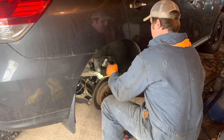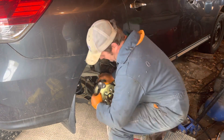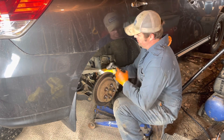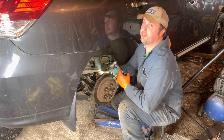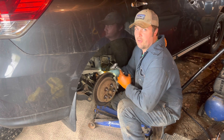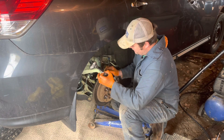We're going to have a look and see what's wrong. Here's what brought me in here — this will not move right now, but when there's weight on it, that will move back and forth. So we're going to put some tension on this, see if we can get it to move and see why. I don't know if you can see this in the video, but this right here will move — the bushing is bad. That's creating a horrible thunking noise when we're driving down the road that has my wife worried that the wheel is going to fall off. I told her all sorts of horror stories about what could happen if that went bad, but the wheel falling off probably isn't one of them. Somehow she didn't find that comforting. So we're going to change this spring — we're going to pop those out, let everything down, two 13s up in here that will let it come apart, and put it all back together. That is the goal.